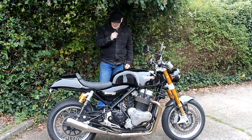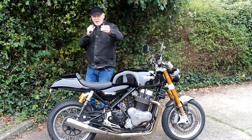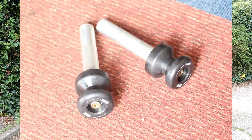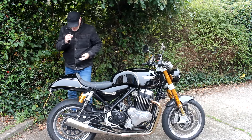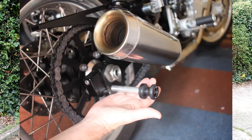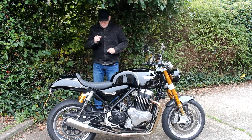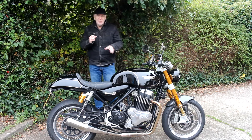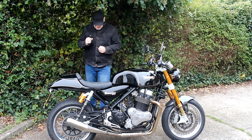I thought I can now finally use these things that I made a few months ago. These are bobbins that are now bolted onto the end of these aluminium shafts, and these go into the rear axle like so. That means I can now use a paddock stand on the back of the bike, because this particular bike doesn't have any fitments on the swing arm for bobbins.